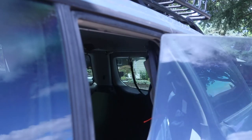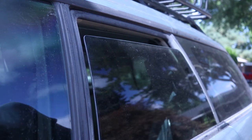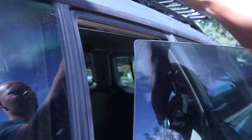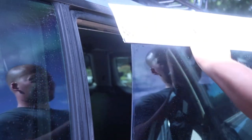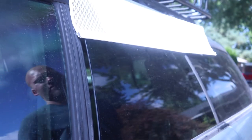The first thing you'll want to do is to roll down the windows to see how far open you want them and to know how big you need to make the vents. Slide the gutter guard onto the glass — there's a channel on the bottom which grips perfectly onto the door glass. Then you'll close the door and outline the shape of the gap that you need to cut out on the gutter guard.